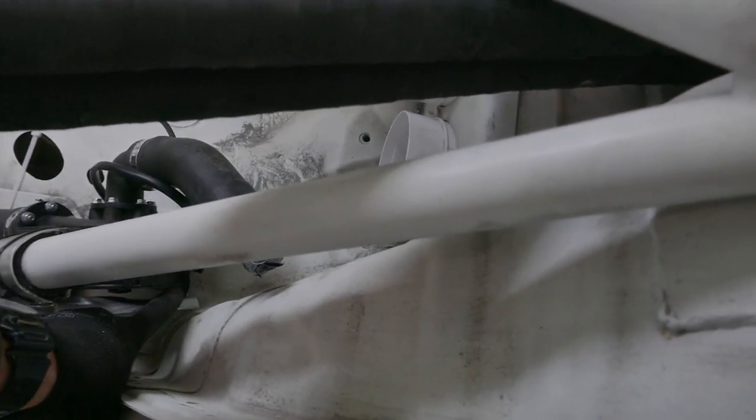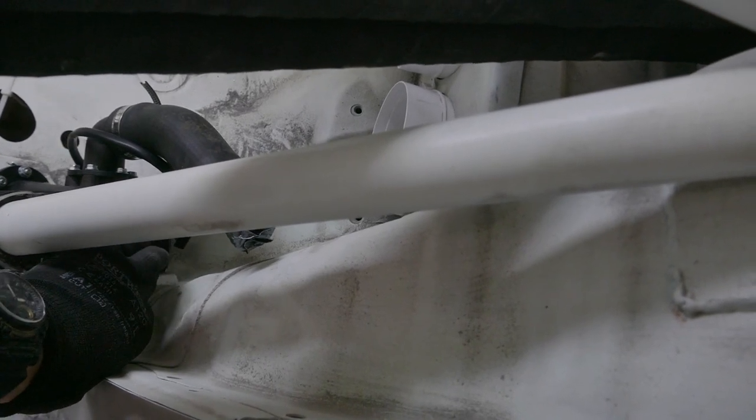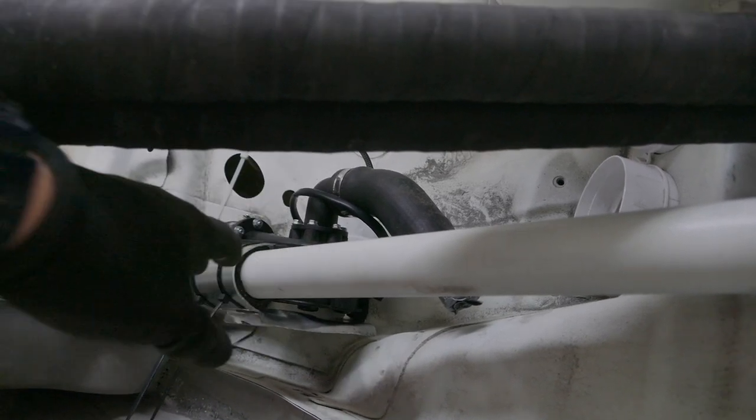Start, but when I go to install it for the final time, I'll put a bracket on this bottom corner and then bolt it directly to the chassis so it stops any flex. I will form this much better so it wraps tight around the roll cage, which will help it hold in place.